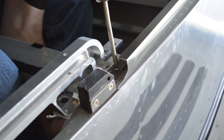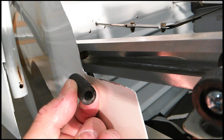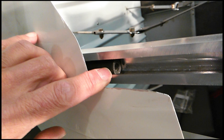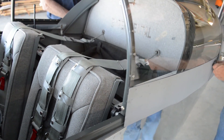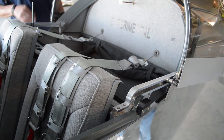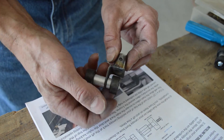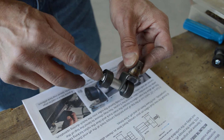At this point you should be finished with the spacer block, so you can replace the canopy track screw that you removed earlier. We've included a short length of rubber fuel line hose. Trim this piece to length as needed and place it inside the track at the aft end. It should butt against the screw for the support bar and provide a nice bumper at the aft end of the track. At this point, double check everything for tightness and proper operation. The last step, which you must do, is to take apart the rollers one last time and apply Loctite to the screws before reassembling. Make sure to keep the Loctite away from the plexiglass canopy as it can cause crazing.